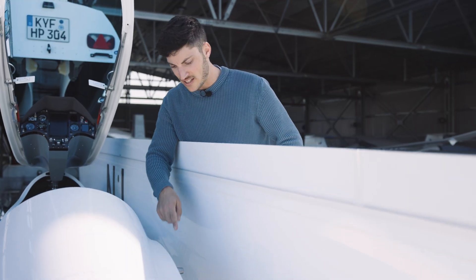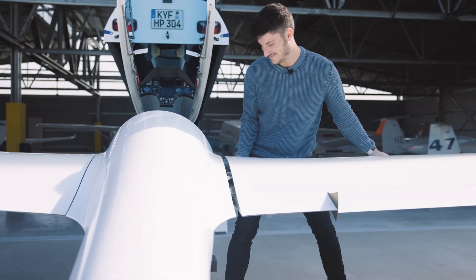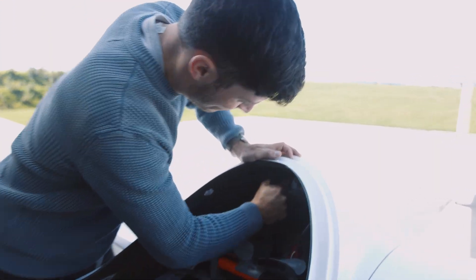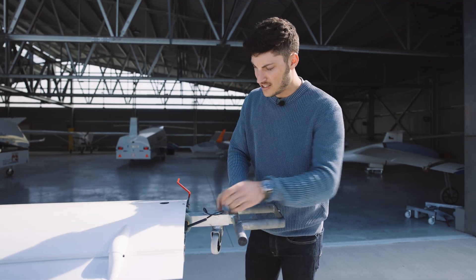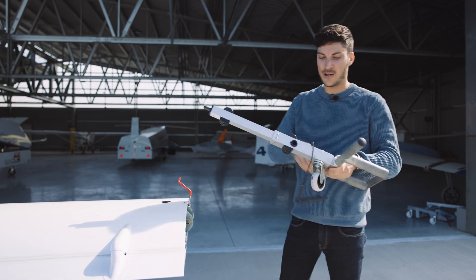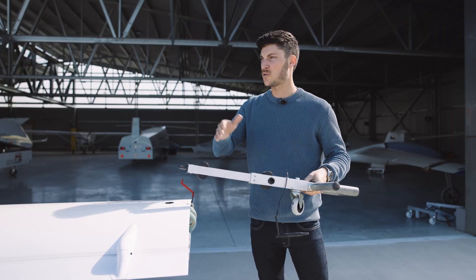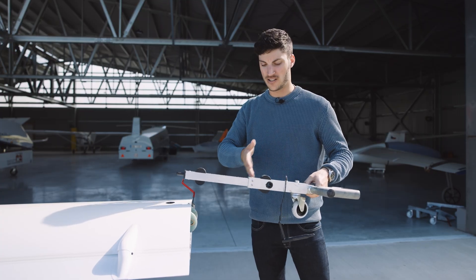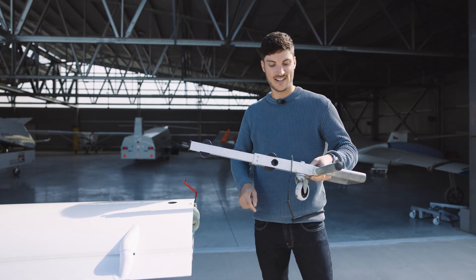Take care that you don't scratch your wing on this pin. Insert the main bolt and then lock it — that's very important. Detach this handle. There is one smart trick with this wheel here: you can put your glider into the hangar without the outer wings, so you only need 13 meters of hangar space instead of 18 meters. It's really smart to have this wheel.